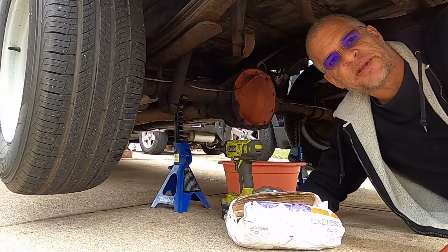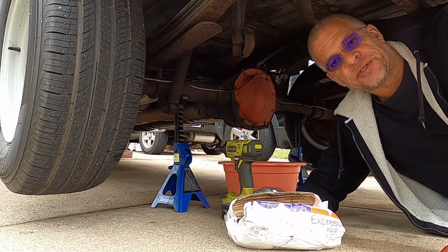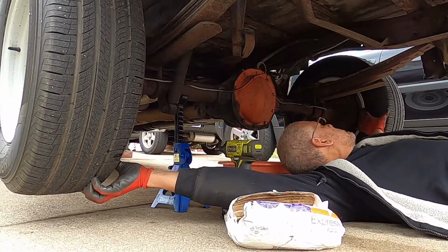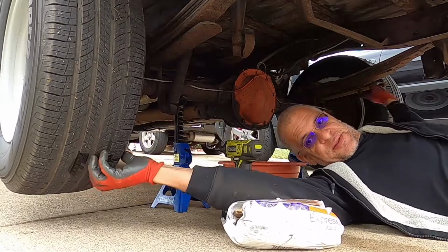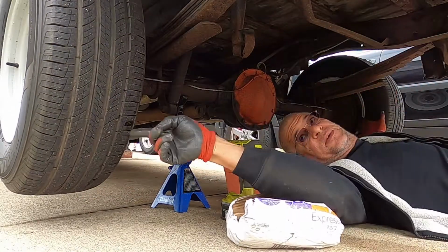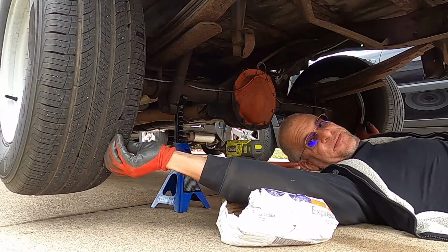So one of the problems I've been having with the C10 going to the track is it's an open differential. That means only one wheel is going to turn when we give it power. That one doesn't turn. Turn this one, that one doesn't turn. It turned a little. We hold it, it doesn't turn.